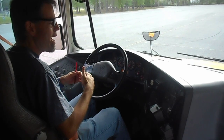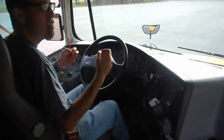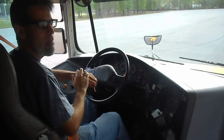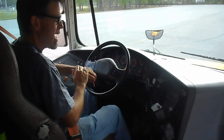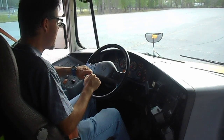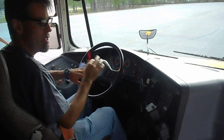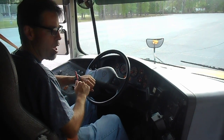Then I look for an extra drop of no more than 3 psi per minute. So I look at my watch, and over the course of 1 minute, I should see no more than 3 additional psi as an air pressure drop. So that's what I do. Now I advise, unless the examiner says it's been a minute and to move on to the next step, take that entire minute and observe your watch.